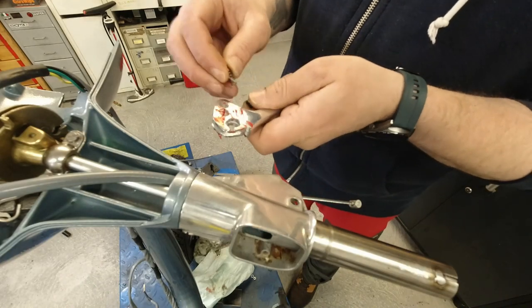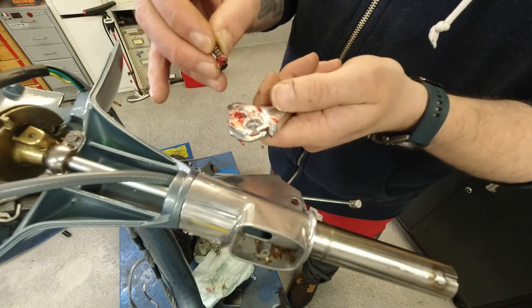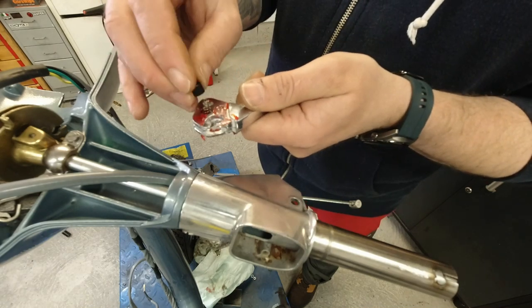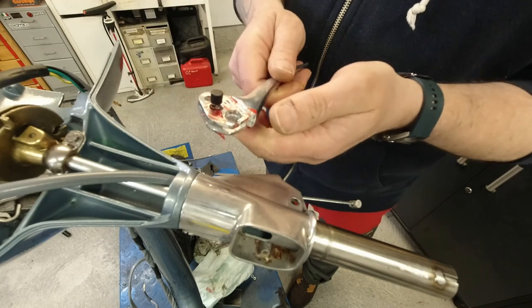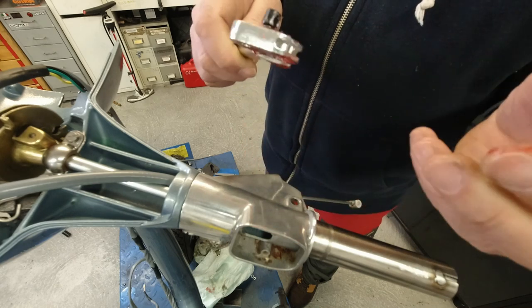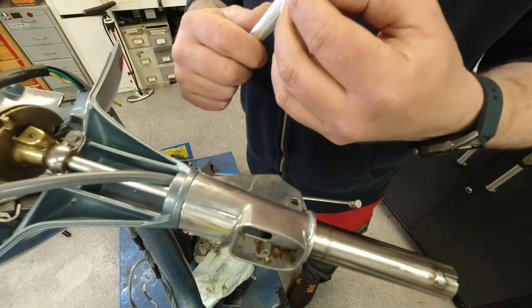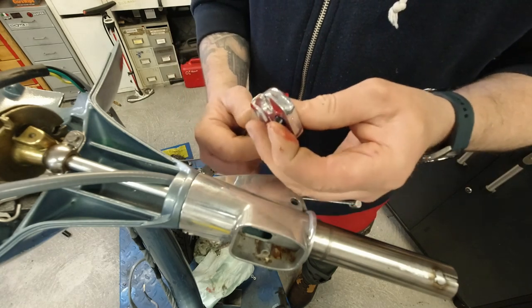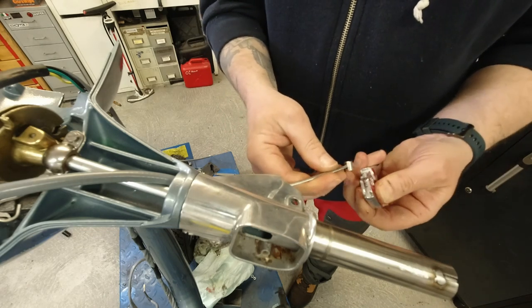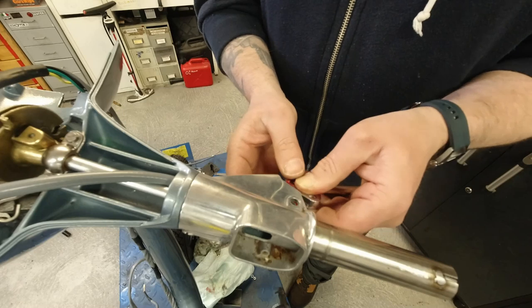And the reason for the blob of grease there is I just put some on this spring. This is the anti-rattle spring and cap. You fit the spring first, it sits there, and then you've got the anti-rattle cap. Quite strong actually, so this can ping all over the place. Good job I bought a few of these. Like that. Hook it on here. Send that through.